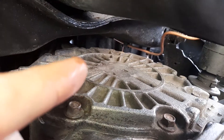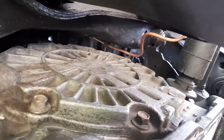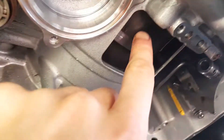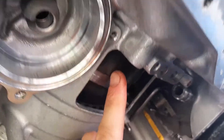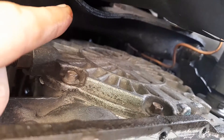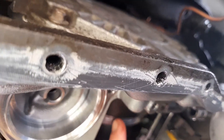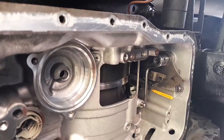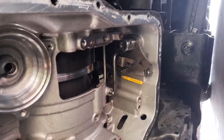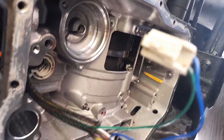I did look up a price for this side plate — it comes with the bush bearing and it was about 150 pounds, really expensive, but these rarely go wrong. Theoretically they've made it really easy to service in these gearboxes, because the brake band can actually be changed if needed by taking this side cover off. You get access to the bolt and the band so you can slip the band off. The anchor bolt — just where my finger is — is what anchors the brake band. You do need to get a new size bolt for a new brake band but you could probably get away with not doing that. That's it, guys — I just wanted to show you this to give you some perspective on where it all goes back, and maybe I'll do another video of it going back in.